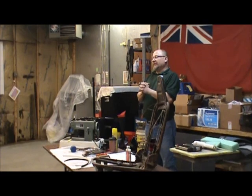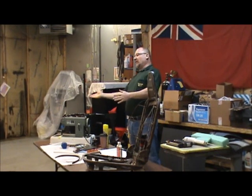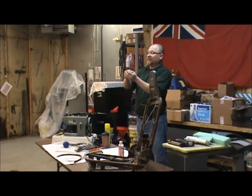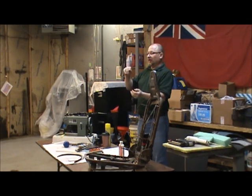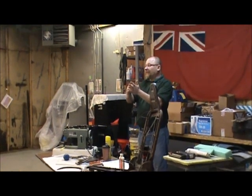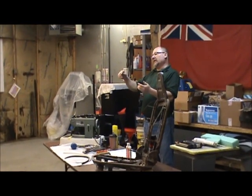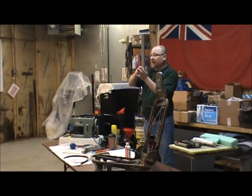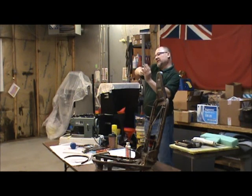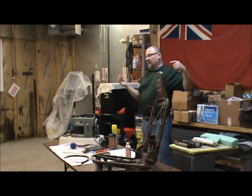But getting back to stains, and working at the dry cleaners, my pop taught me the difference between a water-soluble stain and a solvent-soluble stain. You want to get to it as soon as possible and try to lift it out. Even if you have some kind of oil stain on a nice tan convertible top, just get in there, working in maybe a Windex or something with a little bit of ammonia to try and release it. And even just get out your vacuum cleaner and stick it on there, because it wants to suck out. You don't want that stain to stay in your fabric. You want it to come out.